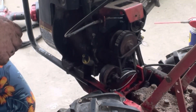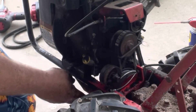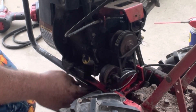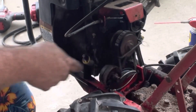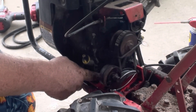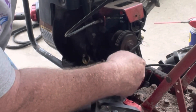Okay guys, I don't know where the camera dropped you off at, but what I had to do is I had to take these four three-eighths bolts loose down here that cover the transmission pulley. Take that off, loosen this, tweak this out of the way, pull the engine pulley off — it's a half inch bolt.